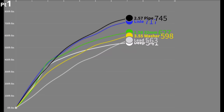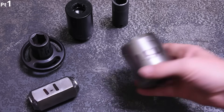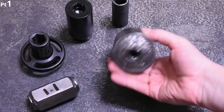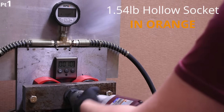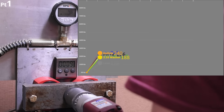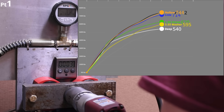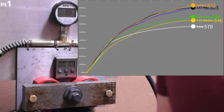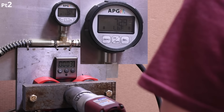You have to find sort of the Goldilocks mass — or do you? We skipped over one particular socket: a last roundup of unused materials from this project. A bit smaller in diameter, though similar size to the black pipe socket, but this one's hollow. Only 1.54 pounds, so much lighter for it. Result: 832. We thought this was a fluke, but it just kept making this — or more. 832 was its median; it made as much as 850. The outside welds on this handmade one again interfere with Honda's crank dimensions, so we need to tweak this, but it's the general principles here we're trying to test.